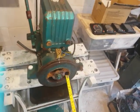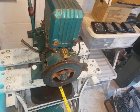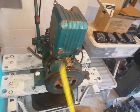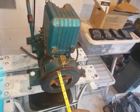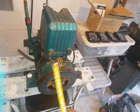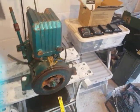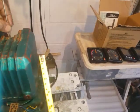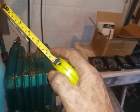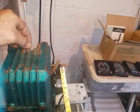If it's further down than 90 millimetres, I'm sorry but this hydraulic method won't work. In that case you'll need a special hydraulic 20-ton press device — it means disassembling the flywheel, then the crankcase, taking apart the con rod, and using a special puller I had an engineer make to pull it out with 20 tons of force. But if it's less than 90 millimetres, you can use the hydraulic spark plug method.